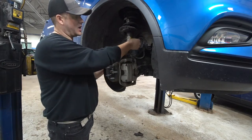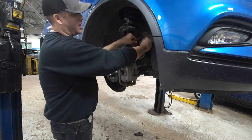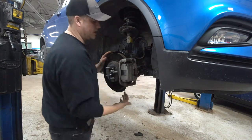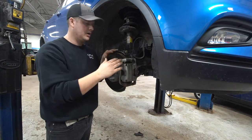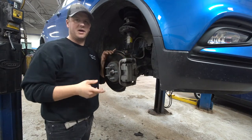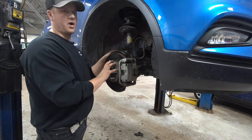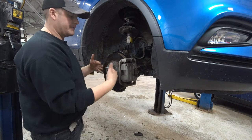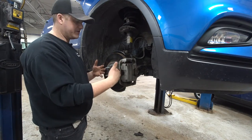Another fault is the wiring itself. The suspension is constantly moving up and down, and this wire moves with it every single time — whether looped or routed along the control arm. Over time those wires become brittle from constant movement, and the wheel turning adds to that stress, so you can end up with a broken wire. So the two main failure points are either the sensor itself due to wiring or the sensor going bad, or the hub due to wear and tear.